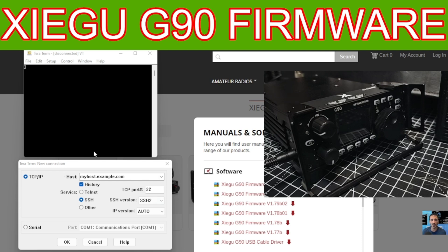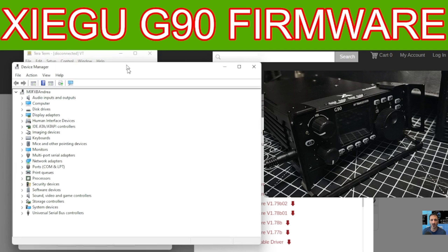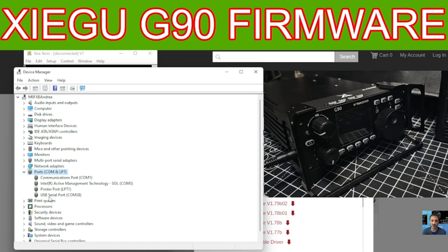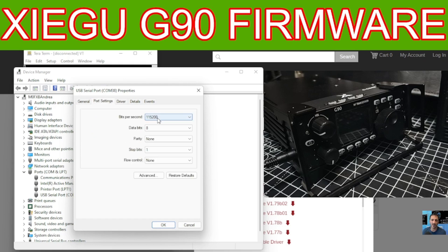You've double clicked, you've got the yellow folder, and you've plugged your cable into the right-hand side — the firmware cable that comes in the box, though you can buy them separately. Now, with these two windows open, right-click the Windows taskbar, go to Device Manager, find Ports, double click it, and you should have a USB Serial Port. Right-click it, go to Properties.